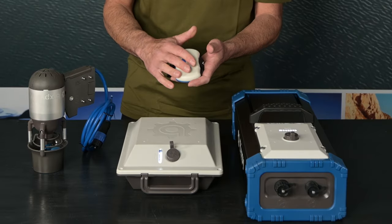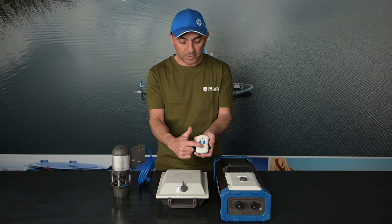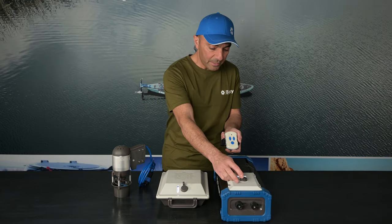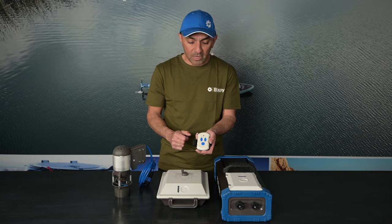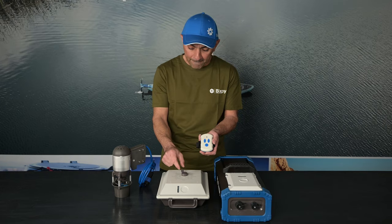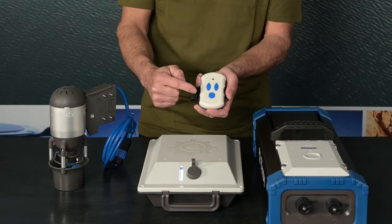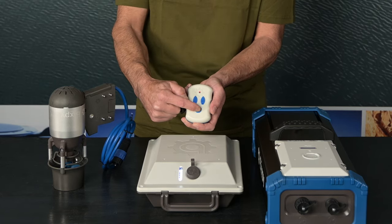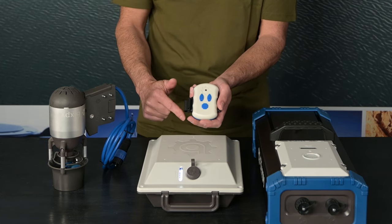Let's cover the remote. The remote is Bluetooth connected to these batteries. If you're connected, you'll hear your battery beep when you press the stop button. To sync the remote to a battery, you put the magnet on, then press the stop button three times — forward, reverse, stop — and give it about three seconds. You'll see that the remote is now synced to that battery.